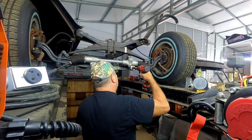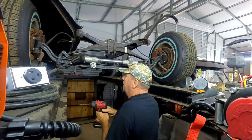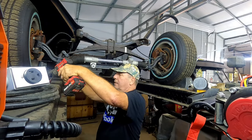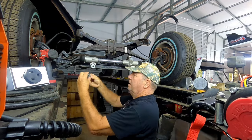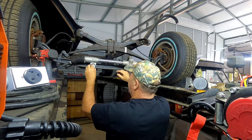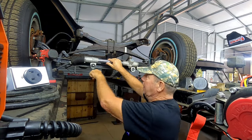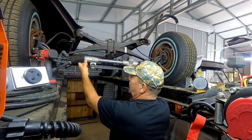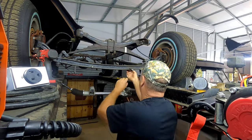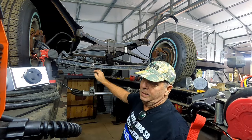I'll actually take this all off. It'll probably hit me in the head. It's always good when you stack up five or six washers in your steering. We'll pull these off. No bushing. Good Lord. So, it's full of washers - there's no bushing in here, which means that this can wobble. It's not a shouldered bolt. They aren't even grade eights. It's just a grade five bolt holding all of your steering. No shoulders. No nothing.